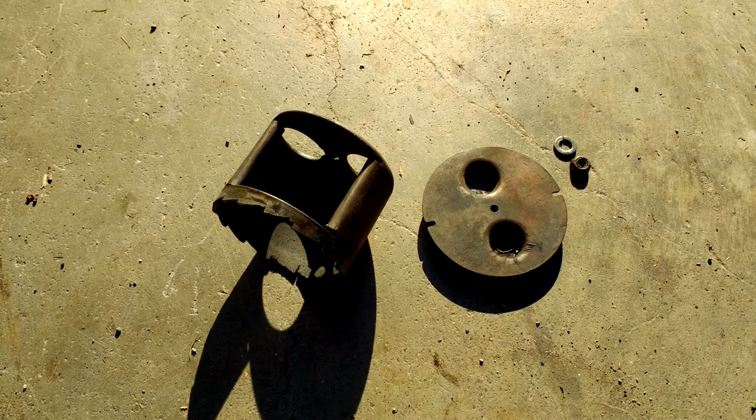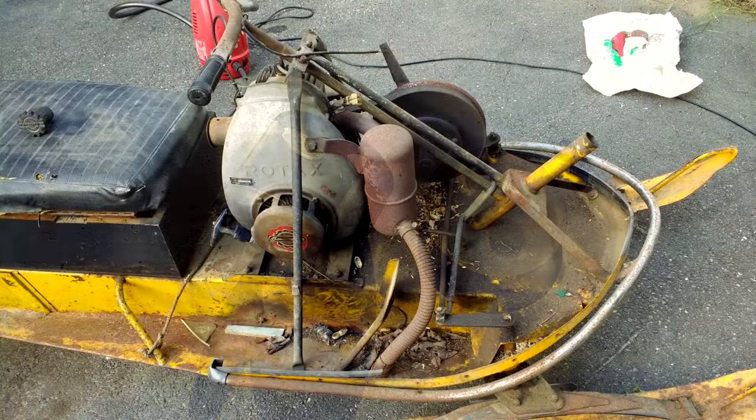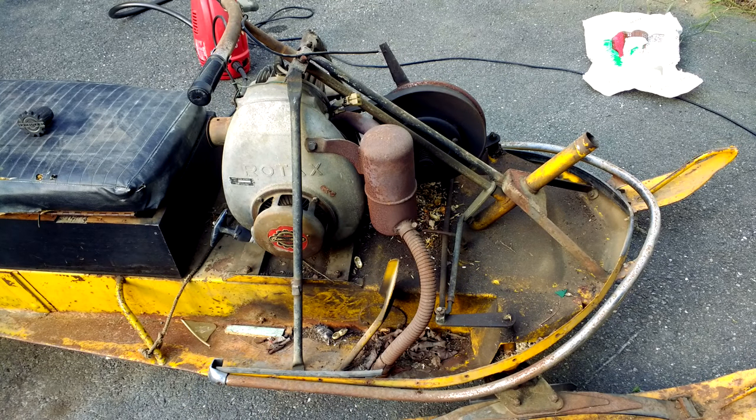To take it even further, I removed the intake, which looks to be some kind of modified hole-saw intake that was homemade. This allowed me to spray some fresh mixed fuel directly into the carburetor. I wanted to prime it and see if it would draw the gas left in the tank from 20-something years ago up into the carburetor — just to know if the carburetor valves are working correctly, or if I need to take them apart, clean everything out, and maybe put in a new kit. So I repeatedly sprayed gas into the carburetor and pulled the rope to start it.